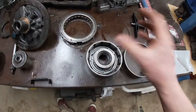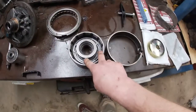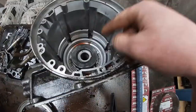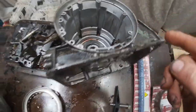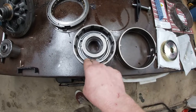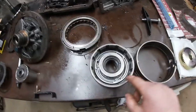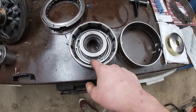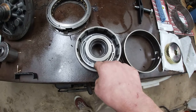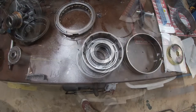and then I thought I'd leave it for the video. So I've got to pull that out, machine that, pull that out, machine that, replace seals, all that sort of crap. First thing I'm going to do is pull this guy out and work out how many clutches I can squeeze into this thing. And same with the reverse side, I'm going to work out how many clutches I can put into the reverse. Because, not so much the reverse, but this guy here, how many clutches you can get in depends on how much power or torque it can hold before it starts to slip. So we'll whip this apart, take some measurements, and we'll go from there. We'll probably have to cut the video off and I'll take this to Ryan's work and machine it up, hopefully. And hopefully I can jam enough clutches in this to make it work.